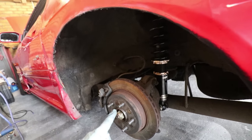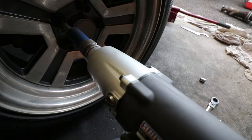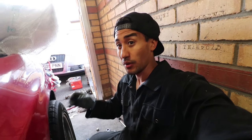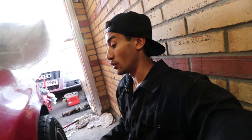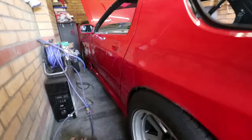Sticking the wheel back on to see what it looks like. I'm only tightening the nuts to about one ooga dooga. The reason I only did one tightening is because when this settles I'm probably going to have to take the wheels off to change the ride height on all four coilovers, so there's no point tightening them to the max when I know I'm going to take them off again. We'll drop this side and do a four-corner check to see how we're sitting.